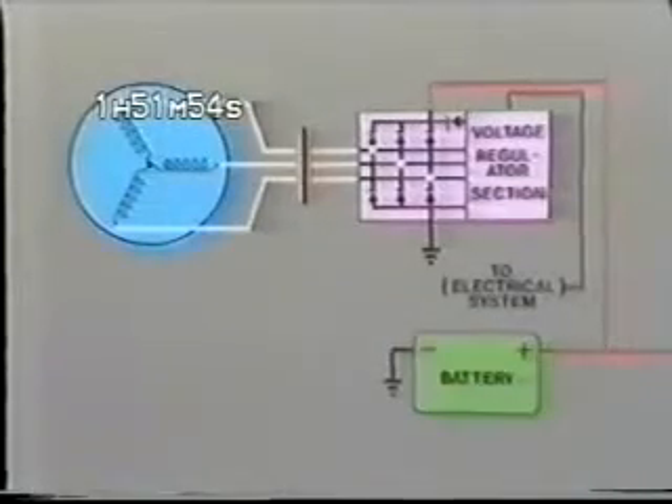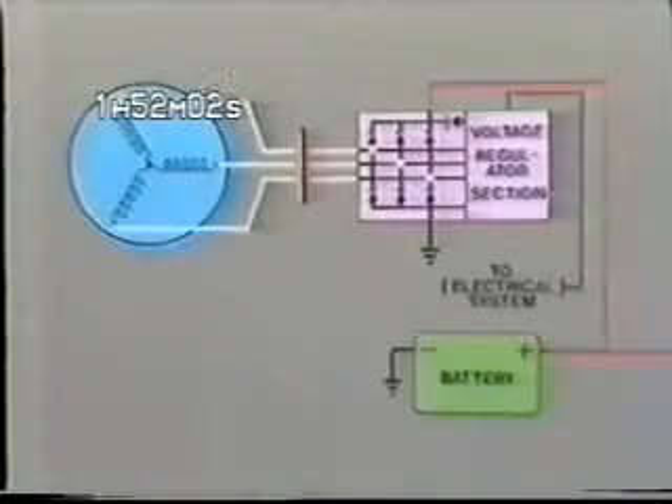In this system, that's precisely what happens. Voltage levels in the electrical system are monitored by the voltage regulator, and if the voltage exceeds 14.5, the excess is routed to ground. When a customer rolls his machine into your shop and the battery's dead, what's the first item you check? Would you dig right in and start troubleshooting the charging system? I hope not, because more often than not, it's the battery itself that needs attention, not the charge system.